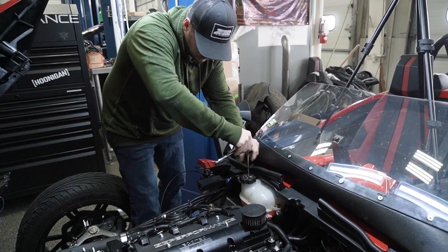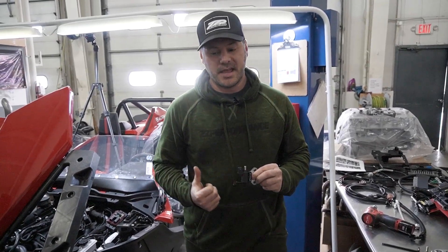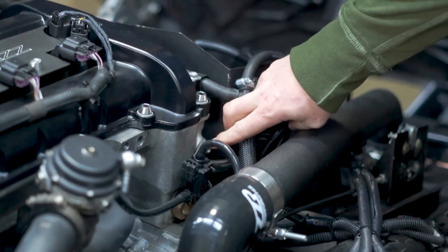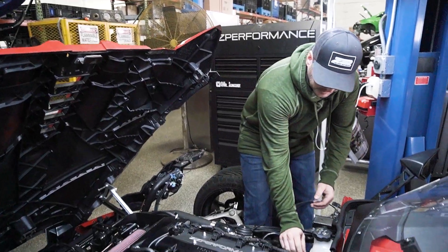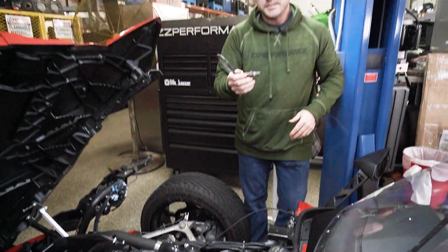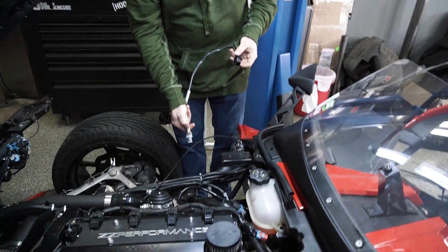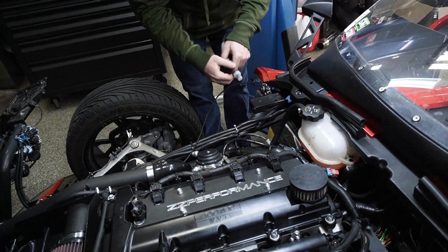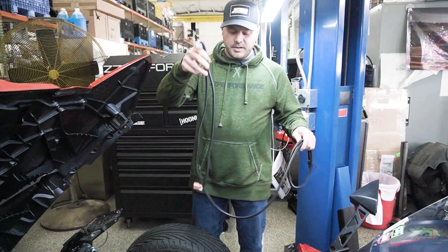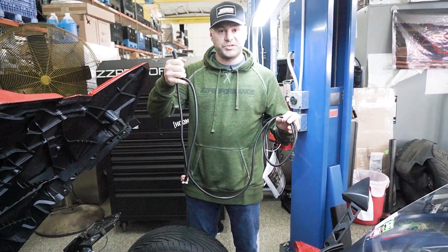With your harness back on, we're going to take out the two 13mm bolts out of your coolant tank to make the next part a little easier. Next up, you're going to take the supplied boost solenoid and attach it to the side of the head. Right on the side of the head here is where you'll attach it at the front with the 10mm bolt that we supply you with. Once you've got that secured down, you're going to need to unhook and take out your O2 sensor. You're not going to need this anymore so you can put it off to the side. Once you've got that out of there, you're going to replace it with your new Haltech wideband O2 sensor. It'll go right down into the downpipe right where your OEM one was, and you'll just leave this wire hanging off to the side for now — we'll connect it to the wideband a little bit later. Your plug-and-play kit comes with a harness that makes the install easier. It'll have the one short leg, which is going to plug into your flex fuel sensor later, and a long leg which we're going to hook to the boost solenoid that we just put on the side of that block.